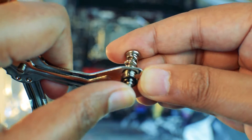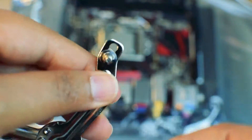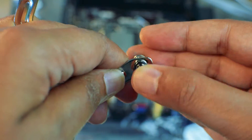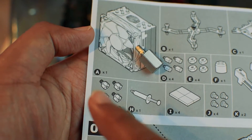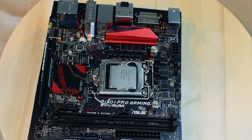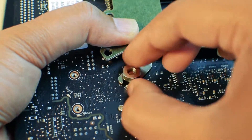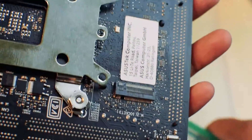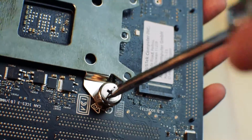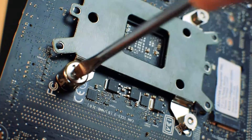The screws can be moved between different positions by pushing the screw up and then pushing it sideways. Four attachments hold the back plate in place from across the motherboard, and they also have the holes required to fit the heatsink. A tool helps you fit the nuts for the attachments without the need for pliers.